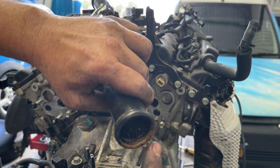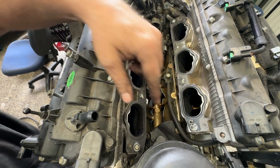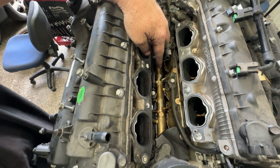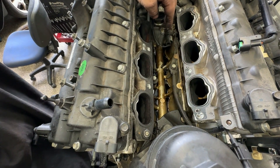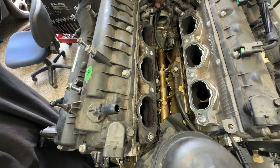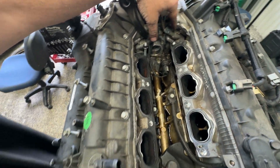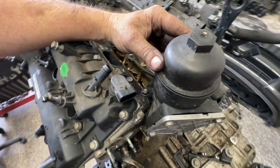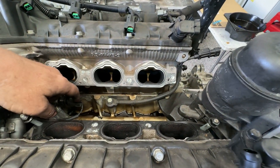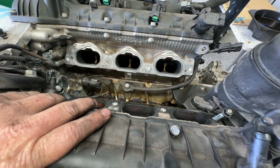It's just sitting in on an o-ring there. A bit more oil evident in here. With the coolant pipe now removed we can see a fair build-up of oil in here. This is the mysterious oil leak that people are often chasing. There is an oil pressure sender here — it's typically not that. You've got your variable valve solenoids up in here — they don't usually leak. Sometimes there's oil spilt during an oil change, but most likely it is weeping up in between the block and the cylinder head. Let's keep going.